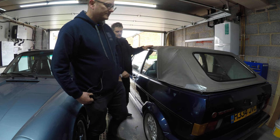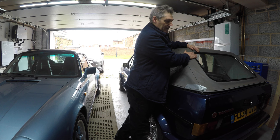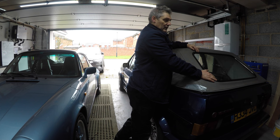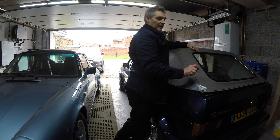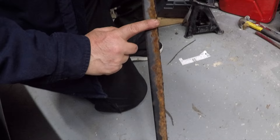And I understand the cars themselves like to rust around this back area around the windows - how's ours looking? The issue with the windows is whenever it rains the water always sits into the lower corner edges and the very bottom edge. Now if the installer doesn't fit the glass and the seal in the correct manner then water will continue to get in, sit at the bottom and it will rot - generally the bottom of the frame. And I think once we take this car apart, Neil will be able to give you an insight and a view of what the rear window frame ends up like. Oh, more rust - great, more rust.